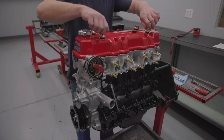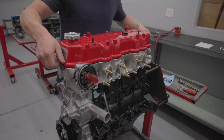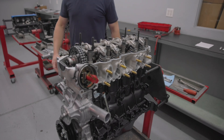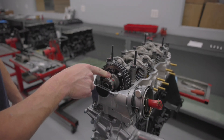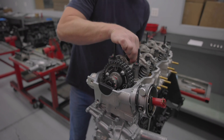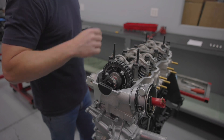Now we're ready to pop the valve cover off. Pull this guy straight off. Now you can look at the front of the gear and you should see the pin lined straight up and down — that'll tell you you're at top dead center. You can confirm it by looking down in here and you'll see that the rocker feet are riding on the base circle of the camshaft and the lobes are pointing away from where the rocker feet are. So you know that both of these valves are closed and you're at top dead center on number one cylinder.